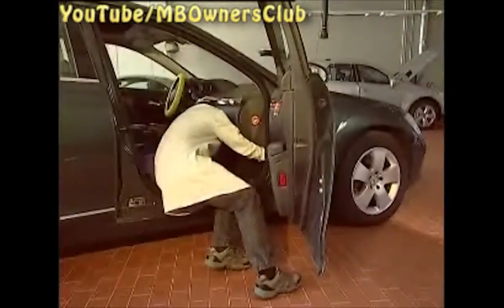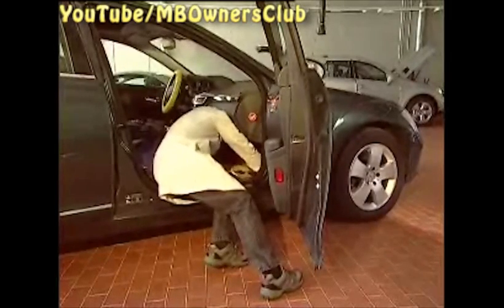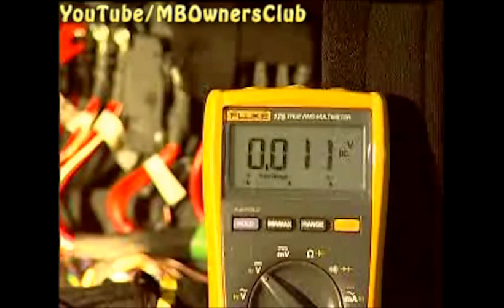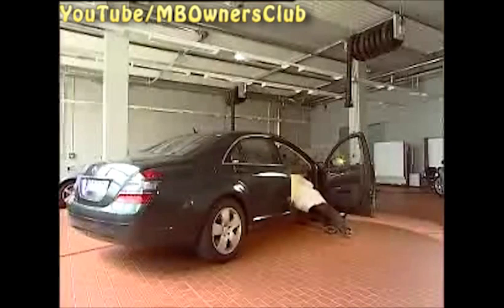Another technical innovation is installed in the fuse box, in the footwell of the passenger side. The fuse box forms the interchange of the energy distribution in the interior of the vehicle. The closed-circuit current switch is also integrated in the fuse box. When required, it switches off terminal 30G. This happens in three cases: first, if the vehicle is off for longer than six hours; secondly, if the main voltage falls under 11.8V; and thirdly, if the closed-circuit current becomes greater than 75mA after approximately 75 minutes. This guarantees that consumer devices with an increased closed-circuit current will be switched off at terminal 30G and the battery will not run down.